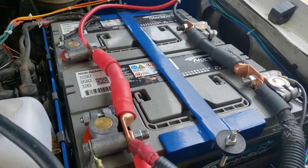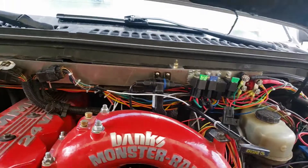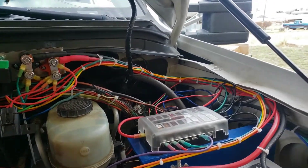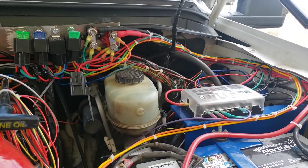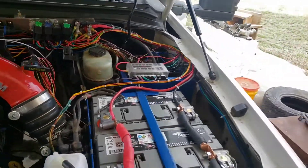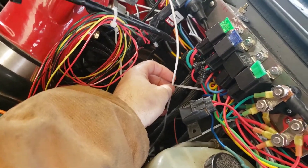Got this stage done - my military battery conversion is done, relays are mounted. I moved my C125 and C126 plugs mounted up to this bar. All my relays are up here: the left one's the fuel pump, then the fuel heater, then the VP44, and the last relay is powering this box which is all switched power. I created a new happy path for wiring over there. There are still a few loose wires and those are going to be part of my next project - a new bulkhead connector where the PCM is. For now, there is no more rat's nest and I'm not worried about anything wiggling loose going down the road. This box is mounted nice and firm, wires are all zip tied together, everything's mounted. This white wire is going to my wait-to-start - that's one of the things I'll be wiring through the bulkhead connector.